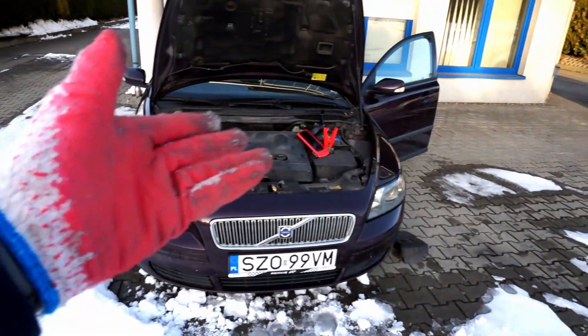As you can see it starts a 2 litre diesel engine without any problem. The first try was my fault — I just forgot that it's winter and I should warm the glow plugs before trying to crank the engine.